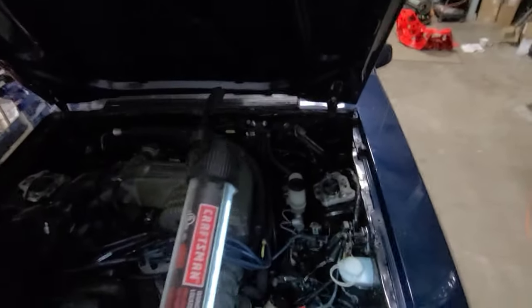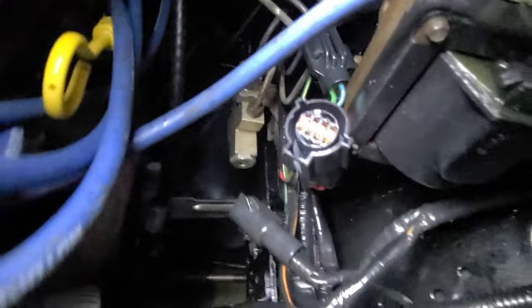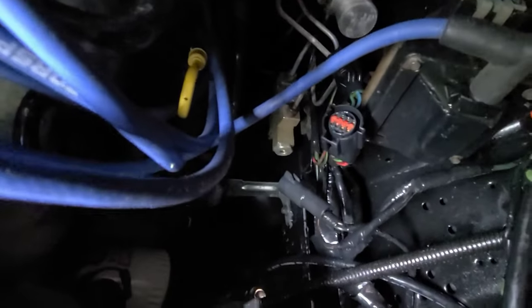And so when I narrowed it down to my problem being in the headlight harness, I took apart the connections and found out that that one right there goes into that one right there, and then the green one goes down here to this one, that's in the front strut behind the battery normally. Well, I pulled it apart and it was full of moisture. And yeah, I degreased it and cleaned it afterwards like I've done a million times. But this led me to find out my problem.